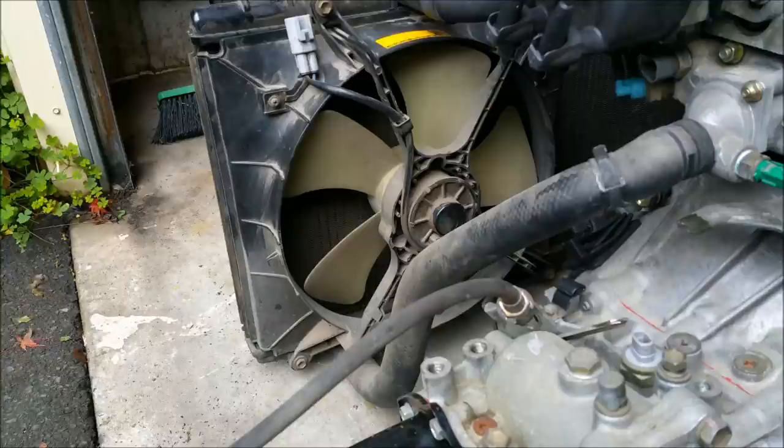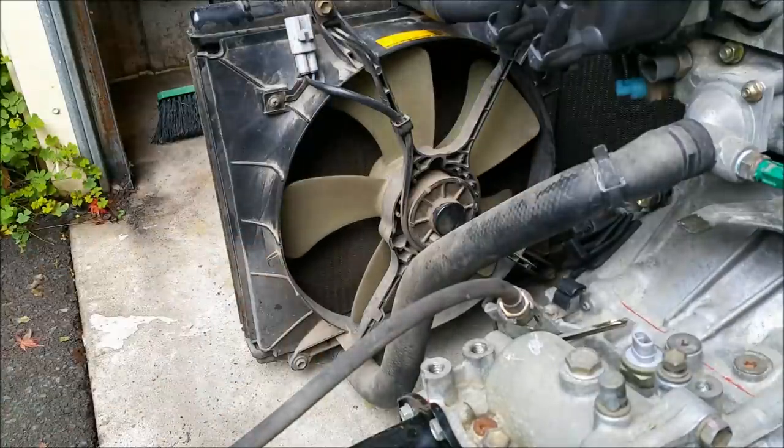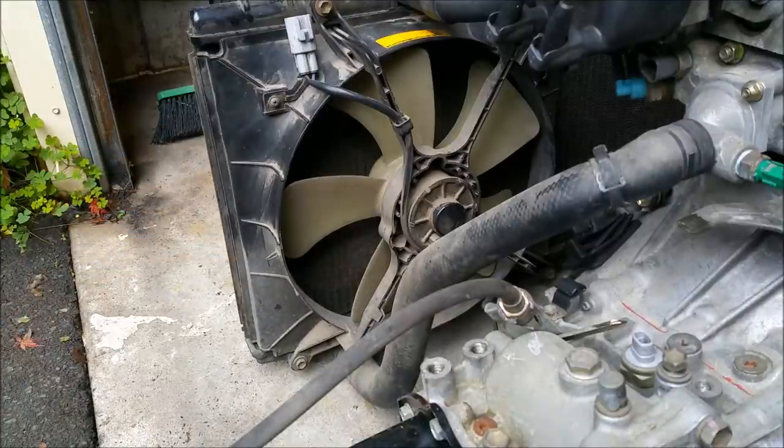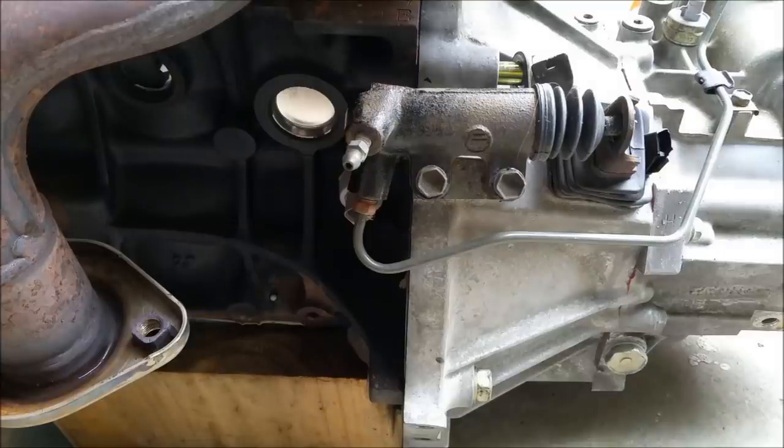The other type of device for flowing air or water is an axial flow fan, and a ship's propeller, for example, is a hydro example of an axial flow fan. It just means when the fan is spinning, airflow is parallel to the center axis of the fan. Another example of that would be a desk fan in your house, or maybe a pedestal fan. The turbine engines on the wings of aircraft have an axial flow fan at the front to feed the turbine engine behind them.